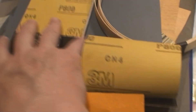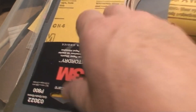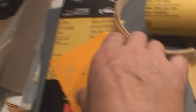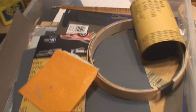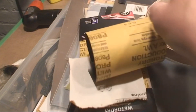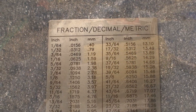Somebody had a question about sanding wet or dry — what's the difference? Well, if you don't use wet sandpaper, it all gets filled with dust and then you're out of business pretty quick. That's why we wet sand — when you throw it back in the water it cleans all the dirt out of the sandpaper. When I wet sand, I like to soak the sandpaper for at least 24 hours. I've had buckets of different grades of sandpaper sitting in water for days on end, ready to go. It makes it nice and squishy so there's no sharp edges on the paper and you can get into any tight spots.